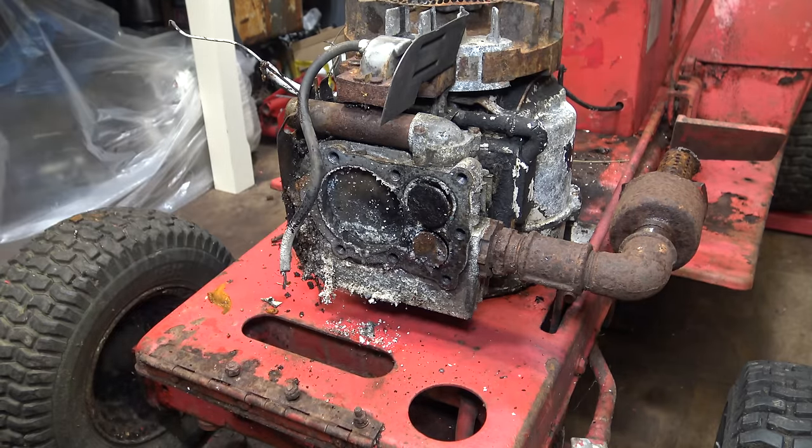Now what you'll probably find is these suction tools won't really work that well on a valve such as this pitted one here. It doesn't really stick to it. It can't create the suction. But if you just add a bit of clean water to the end of it, not too much, just dampen it, it will stick better than it would do without. But this nice clean valve here, it works very effectively on.